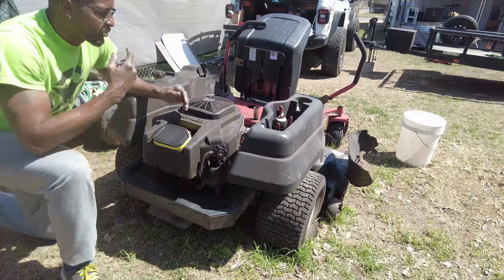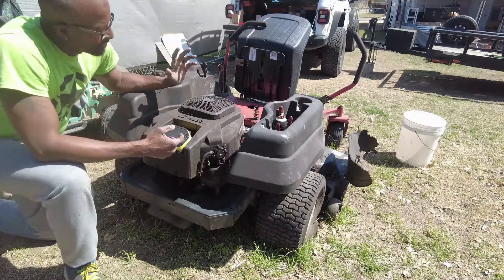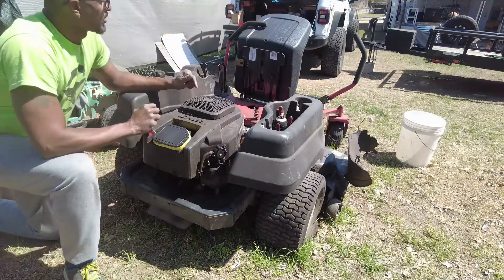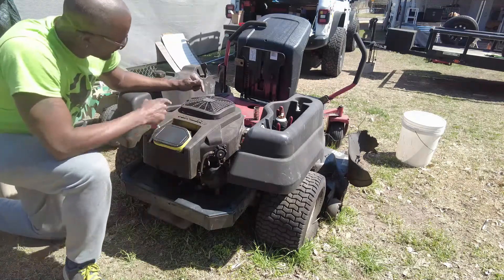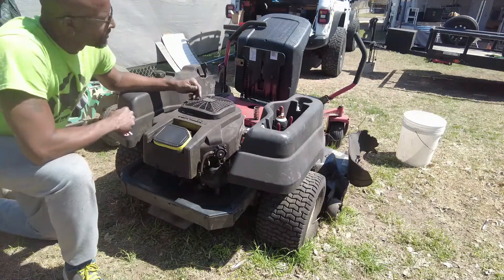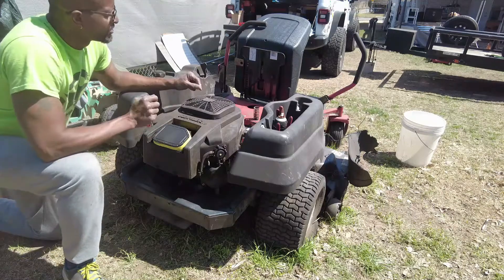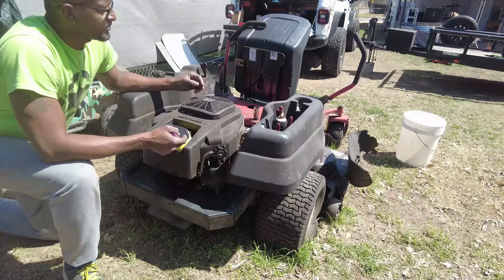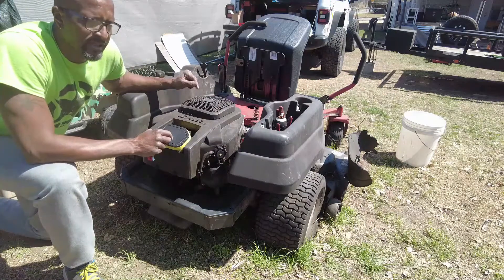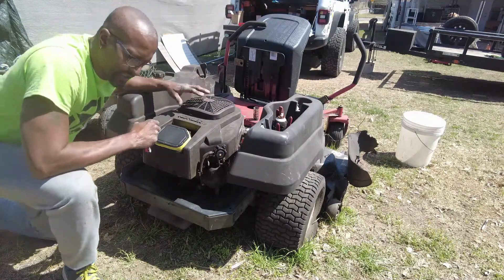All right, here's the moment of truth. The gas line is empty so it's probably going to take a minute for fuel to pump down, but let's see what we're working with. Changed out the spark plugs, fuel pump, fuel filter, new line from the tank to the filter, and the air filter — everything's done. Battery's good, so it should turn over enough to get the gas pumping. Fair warning: this thing is loud because there are no mufflers on the back — I got two mufflers I need to put on — but we're not concerned about that right now. Let's get this thing cranked up.